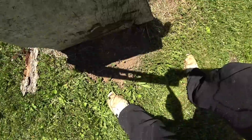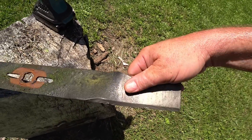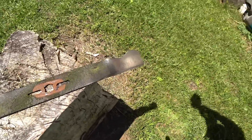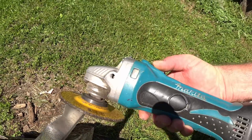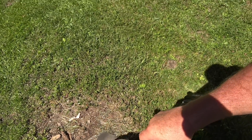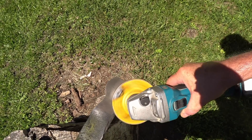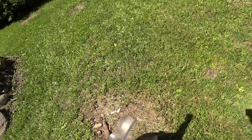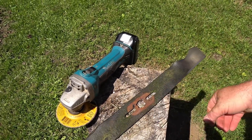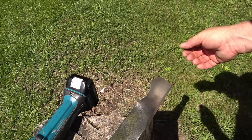You see the blade? It's got a bevel — the bevel's up. And then it's supposed to be the flat side down, except the flat side on this is pretty rounded. The other side's not as bad, but it's not even close to sharp. So what I'm going to do is put my foot up on that, hold my grinder with one hand, and start sharpening. I'm going to do so much on that side first, and then flip it around and do the other side, because it's making it too hot. You really want to maintain that bevel. Don't grind up at the tip to get it done quick — try to evenly grind it right across.